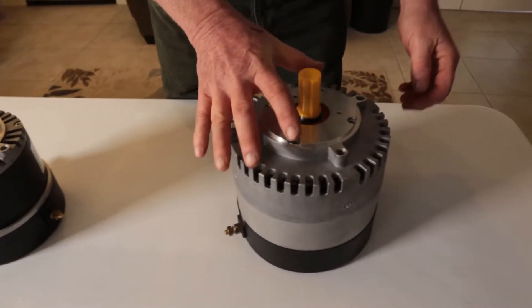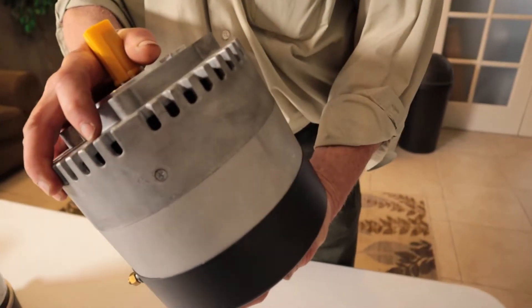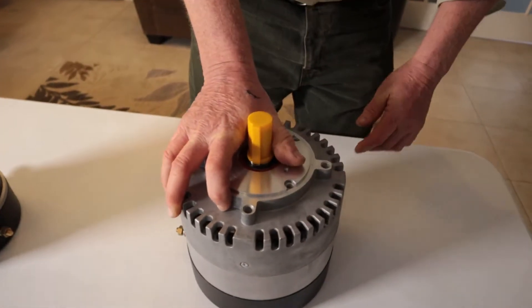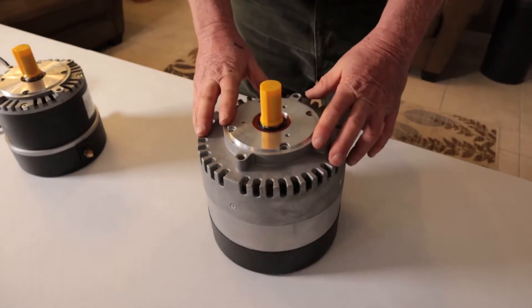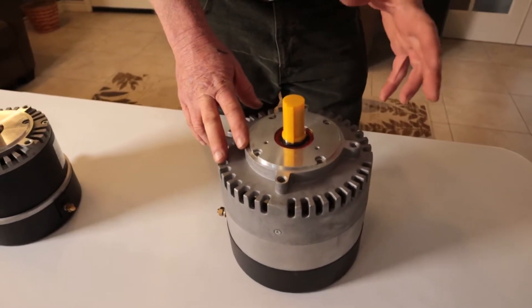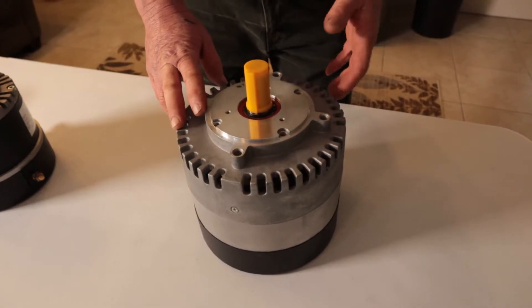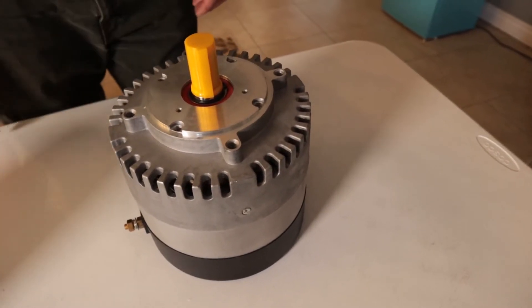This motor here is a much more serious motor — it is powerful enough to drive a small car. It will drive a small car at 50 miles an hour, 2,500 pounds or about 900 kilos or less. This motor runs at 72 volts and as high as 400 amps, handling 200 amps continuous. This is probably one of the best motors on the market right now for efficiency, horsepower, size, and durability. It is tough because it is a brushed motor, highly efficient because it uses rare earth magnets, and it's very well engineered — it has 8 brushes in there. It's just about the best motor that money can buy right now for the size, weight, and horsepower.